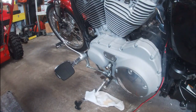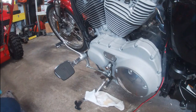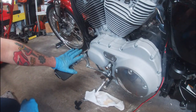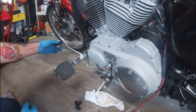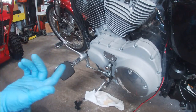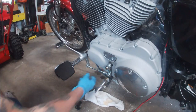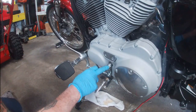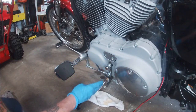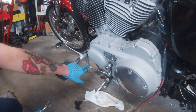We're back. Today's video we're going to try to do a little adjustment on this shifter. A lot of times people put these on forward controls and adjust this — if you're wearing a regular work boot you can't get your boot under it, it hangs up. So technically this thing needs to come up a little bit. I'm hoping I have enough adjustment on this rod to be able to spin it and push this up further. Otherwise I have to remove it from the shifter spline and rearrange that, but right now it's in the position it's supposed to be — straight up and down.